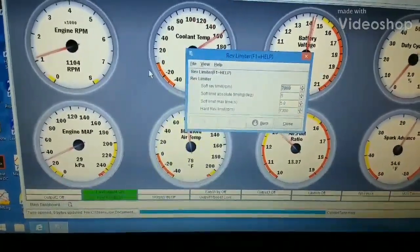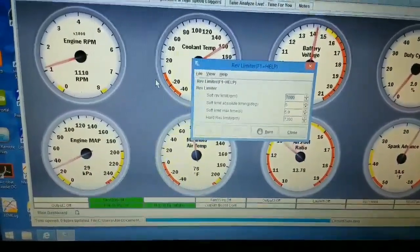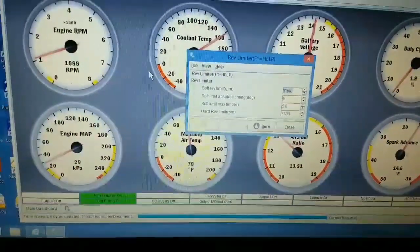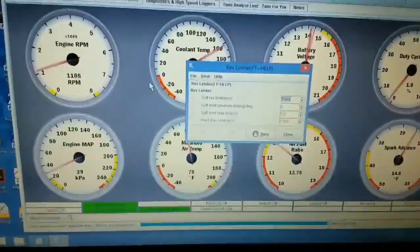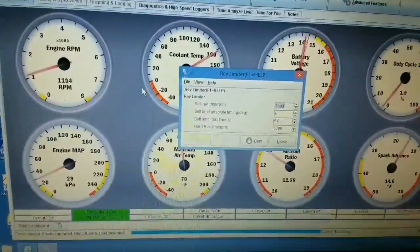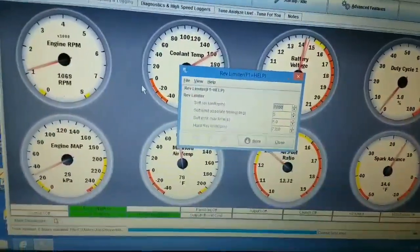Key to keeping an engine together is also not putting too much RPM in it. But I've talked to a lot of guys that have actually ran these things to 8,000 RPMs, and they told me 8,000 is where we start to have an oil pressure issue. So you gotta shim the pump.